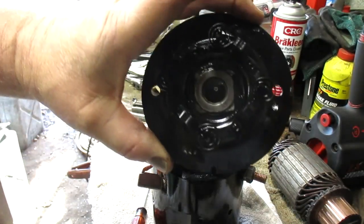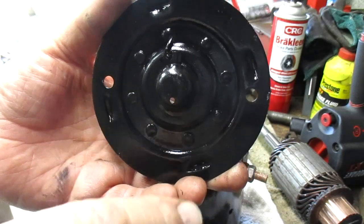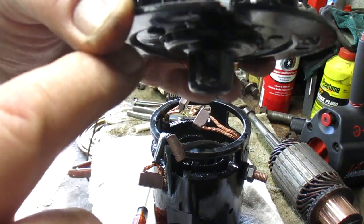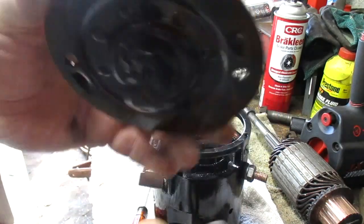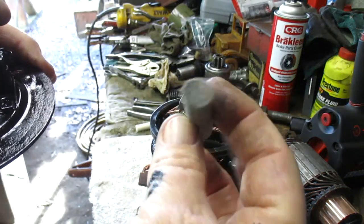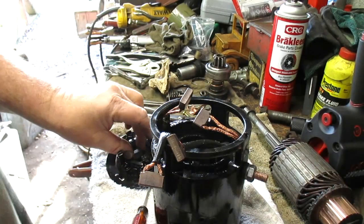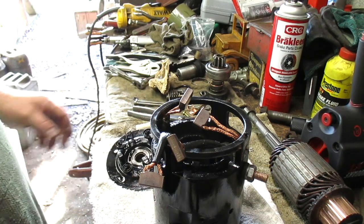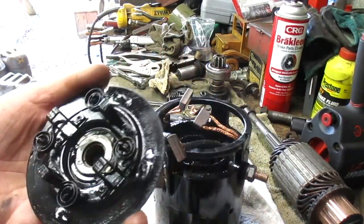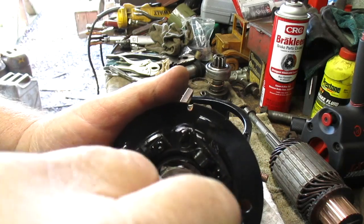The end cap brush holder has a weep hole in it to let oil out. I don't have any felt in the hole. You can't see through there, it's too dark in here, but you can see through the weep hole. So I have this felt. It's not exactly the same diameter, it's a little bit smaller, but I cut a piece and I put a little bit of wheel bearing grease to hold it in place. And I'll put a little bit more in there too to help hold it in place